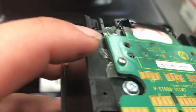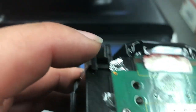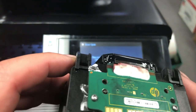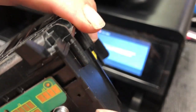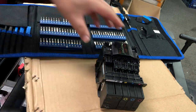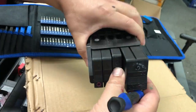I raised the lever and took the whole printhead carriage out. I found some plastics and aluminum foils underneath. The customer bought this on eBay and she doesn't know the history of it. If you've never taken a carriage apart, let's do it together — take this carriage apart and find out what those aluminum foils are. Almost all the screws are T8, so there are only two smaller screws, the T6 screws. I'm going to remove six T8 screws: two in the back and four on the top.